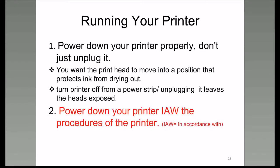If you unplug it, the printer doesn't move at all, the ink dries up in the printhead, you go to turn the printer back on, and you've got a problem—the printhead is clogged with dried up ink. Properly power down your printer when you're going to turn it off. My rule of thumb: if I'm going to leave the house for more than three days, I turn my printers off. Otherwise I leave it on even if I only print once or twice every three days.